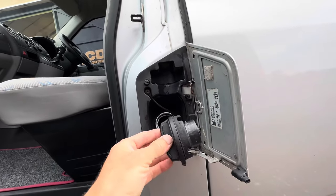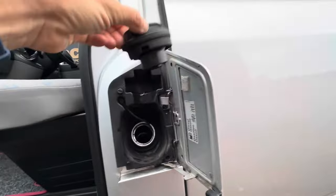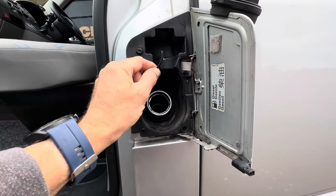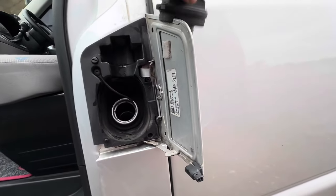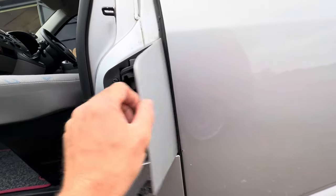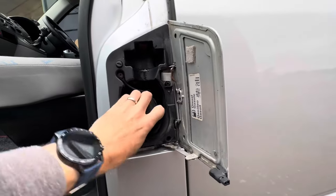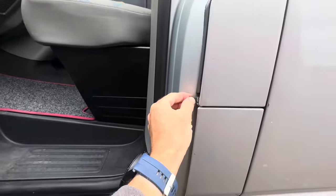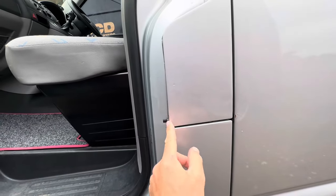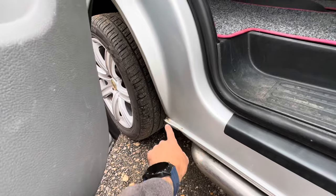These springs are really cheap - less than a fiver - and that'll get your flap working as you'd like. Worth mentioning: when you take your diesel cap off, it either fits in the little recess Volkswagen designed for it, or it clips onto the top of the flap. You'll probably find the little tail that keeps it in check has broken. These little plastic trims disappear as well - they're not expensive, just clip on, and stop the flap from opening when the door is shut.